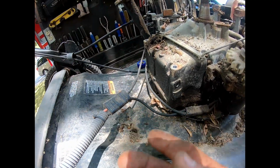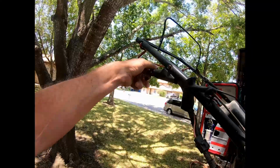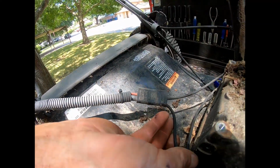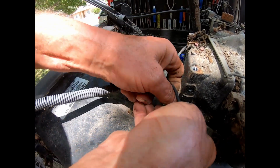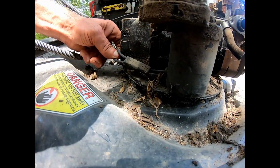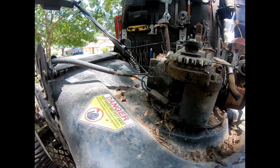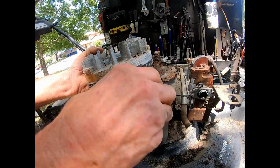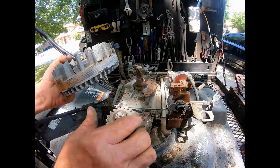coming from the battery that runs all the current through the switch. So when you turn this switch to start it, you're actually closing a circuit that is running the current from the battery directly to these two wires into your starter. It's got a reduction gear on it here that spins your engine. What it does is when it spins, it kicks these teeth up. The Bendix arm kicks the teeth up, engages the teeth into these gears. The engine turns, boom, you start the engine.